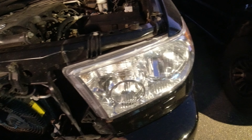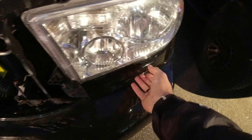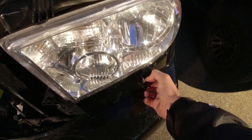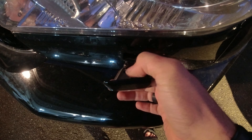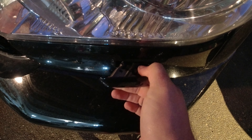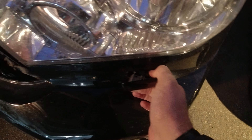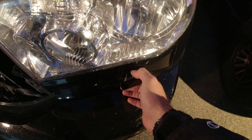Removing the headlight is super duper simple. In order to pull this panel off, you have to pop these clips. You can't pull this panel off until you remove the headlight washer itself. The headlight washer is so simple to remove — you have little pry clips on the top on the stopper and you're going to pry this off with a flathead, then the headlight washer unit will pop back into its pocket. Once that's back in there, you can pull this plastic cover off.